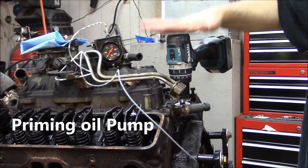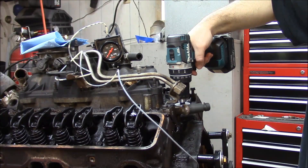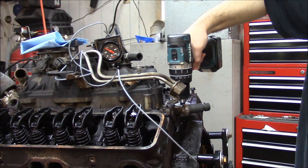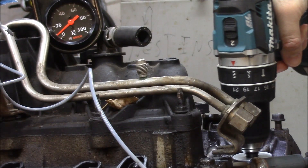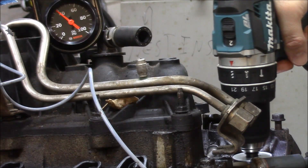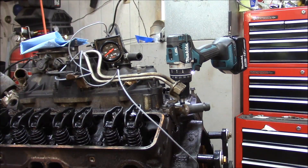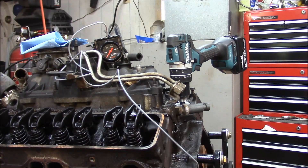When you're priming your oil pump, don't push down on the drill — just pull the trigger — because your distributor doesn't press down on it, and you'll cause excessive wear on your oil pump gears. The oil pressure reading is not bad; I usually see about 40-plus PSI on a regular engine. I did read about people getting more PSI when they removed the oil cooler, so we'll see how it goes.